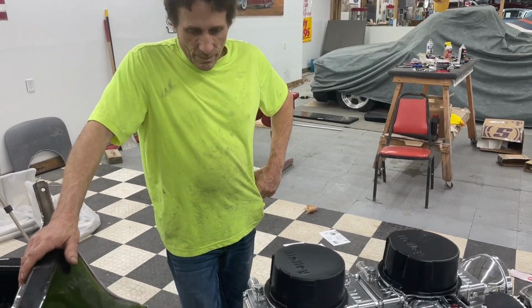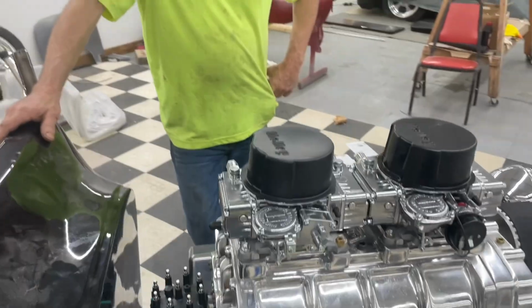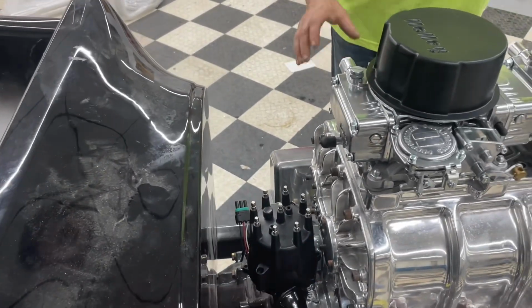It'll all be beautiful. Okay, here we are. So just spin up some oil. We put some oil in it, 5 quarts. And I pulled the plug and drained it. There was just a little bit in there, just to make sure it was empty. So put the filter on, pre-filled the filter, put the filter on.